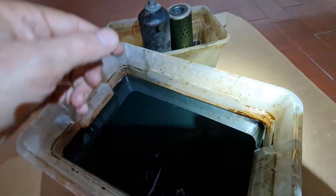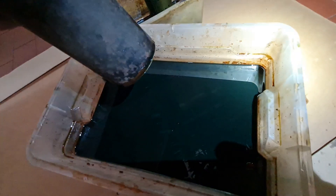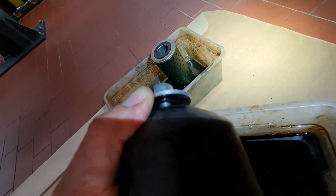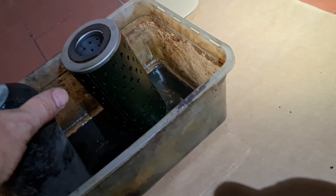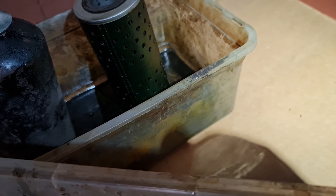I changed the oil here and I just wanted to show you how that originally looks. There is a clamp in there, a spring clip, and you can see that down there — this is to avoid your internals dropping down into the oil and getting lost. There's a rubber seal in there at the end of the bolt. That needs to be replaced, and the filter needs to be replaced. This is a green one and it looks very original — this is how they were.